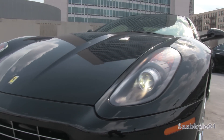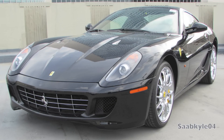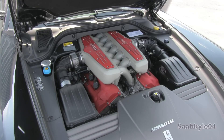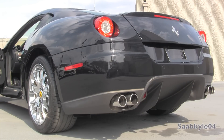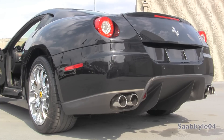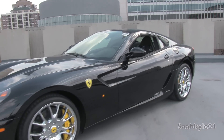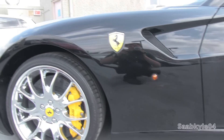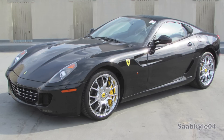The 599 boasts a front-mid-engine design, placed as low and as far back as possible. A new V12, derived from the Enzo, posted key advantages over the previous mill in the 575. Not only is the engine 42 pounds lighter, but it's also stiffer, more compact, and boasts a 14% increase in power. Measures were taken to quieten the engine, creating less mechanical noise interference up front and allowing a cleaner, more pronounced sound through the dual-mode exhaust. With a race-derived dry-sump lubrication system, the crankshaft is mounted two and a half inches lower, allowing for a lower hood and lower center of gravity. The rear-mounted transaxle gives the car a 53% rear weight bias, and Ferrari claims 85% of the car's weight resides between the axles.